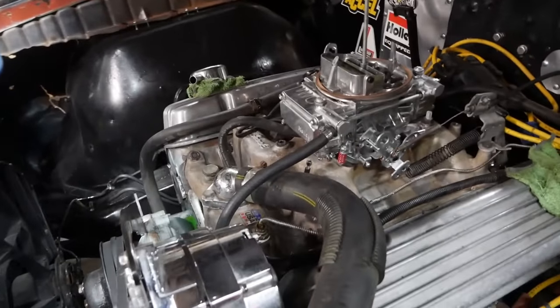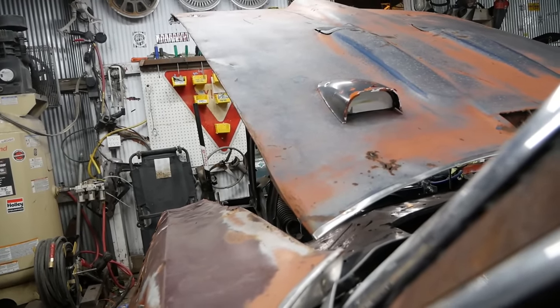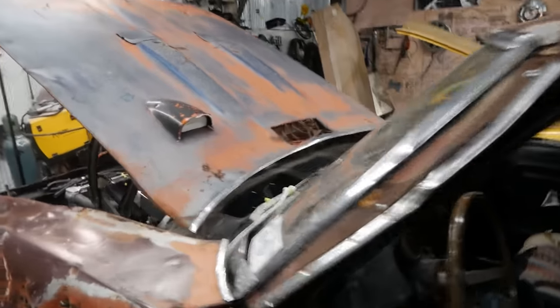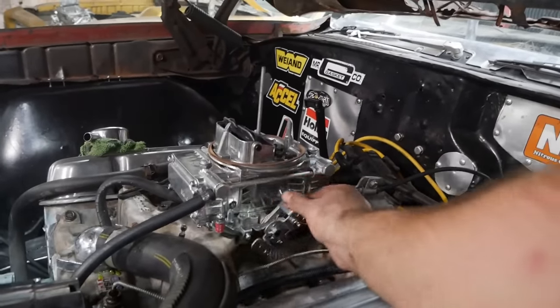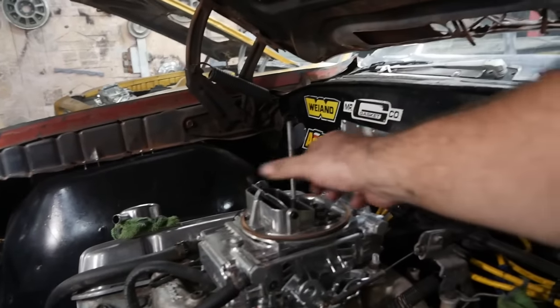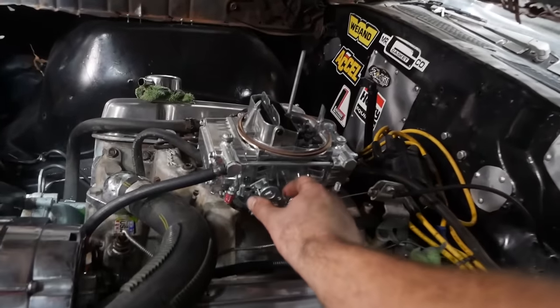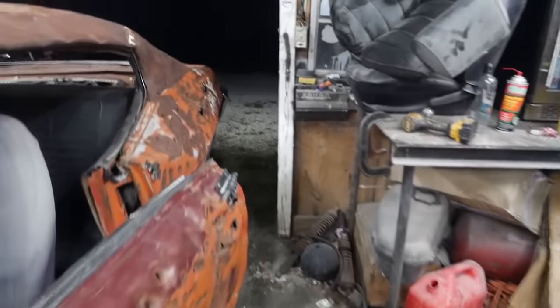All right, we're buttoned up. Had to move the fuel line position. Let's see if it runs — I think that RTV's had enough time. It took a minute for it to fill up. It's still super rich — I pulled the idle screws out to one and a half turns. It runs decent, pretty rich though. It's just a 625.